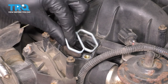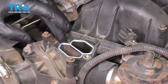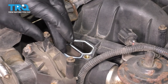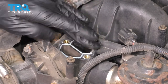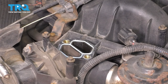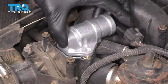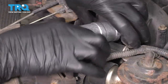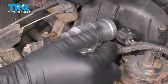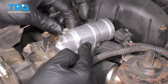It's always a good idea to install a new gasket. Set that down in place. If you absolutely have to reuse your old one, you can. Just make sure it's still pliable, not squished or damaged. Basically, you just want to make sure it will seal up all the way around. Then take your new IAC valve, place it up on top here, and line up the two bolt holes. Start your two bolts in.